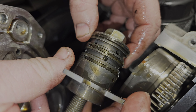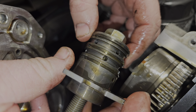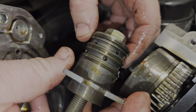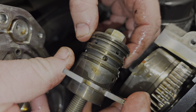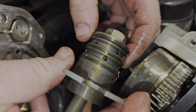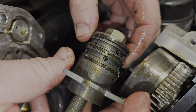These cams aren't as bad as some we get, but with this being a 507 and the warranty company footing the bill, we're replacing them. We don't like that wear — it's only going to get worse. Changing them now prevents catastrophic damage. Some tappets are also bound up in the head — that's another reason to replace them. They go through heat cycles and wear just like anything else. This car is low mileage and well-maintained, a 507 — best of the best — but earlier generation C63s and E63s will show a lot more wear and tear.